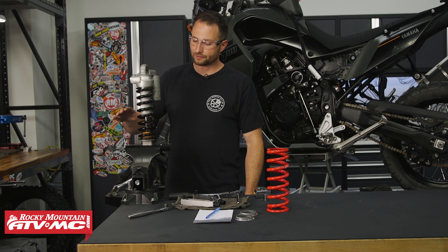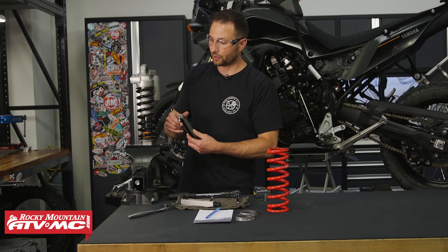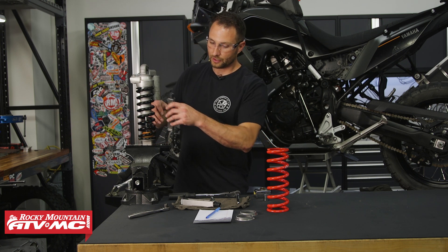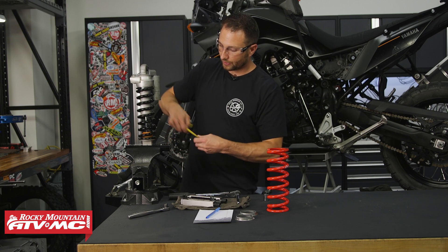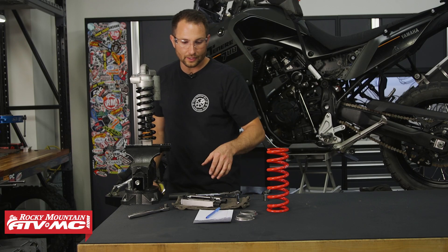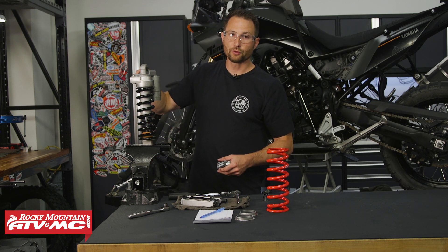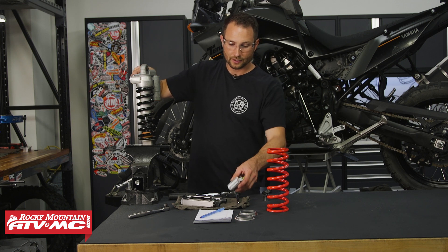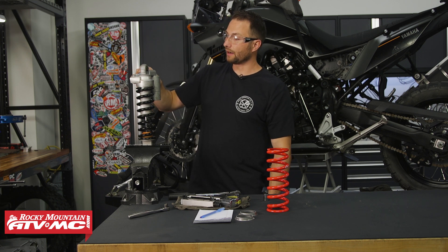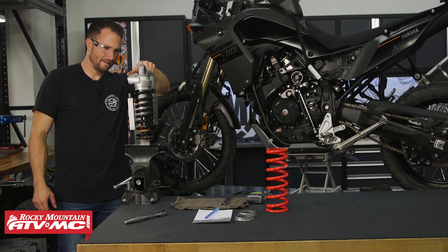Now with the shock over at the bench we have a vice with soft jaws. If you don't have one that's fine — you can just do this on the bench and use the two spring compressors the same way. Having a vice just makes it a little bit easier. I've gone ahead and measured this spring — I've got 229 millimeters of compressed length. After that you can remove the preload from this adjuster. I've backed this off 12 full revolutions and that's going to help make it easier to remove that spring.